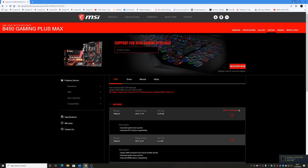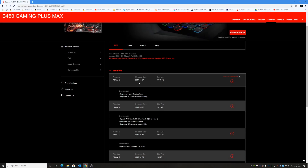The first thing you want to do is head over to the MSI website and get the appropriate BIOS for your motherboard. This one is for the B450 Gaming Plus Max — I'm on the support page. Depending on which motherboard you've got, download the appropriate driver. In the BIOS section, go for the very first one at the top, which is the latest version dated 7.11 2019, and it's a 14MB size. You will need a USB drive of at least that capacity, if not larger.